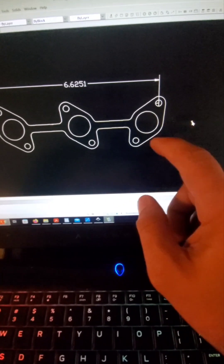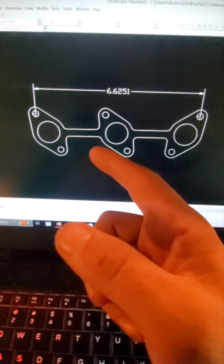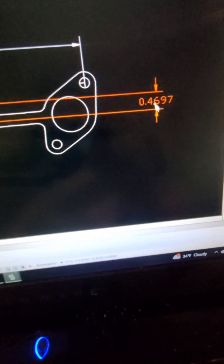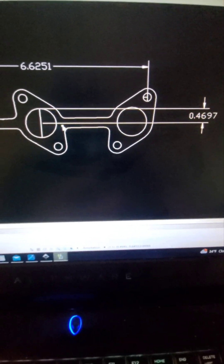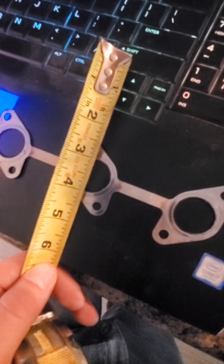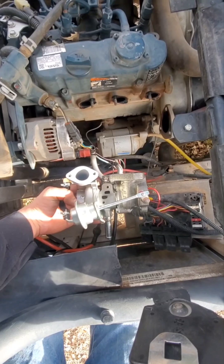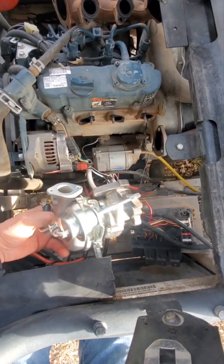I'm going to come back in here and add some mass, make this thicker across here. I'll probably cut this out of three-eighths or five-sixteenths. Dimensioning this hole, it comes out to be a 0.9-inch hole, so inch-and-a-half schedule 40 pipe fittings will not work the way I intended — I basically need to find one-inch pipe fittings. After I get a flange going, I want to mount that turbo somewhere right in there. It is kind of a lengthy turbo manifold — so there you go, part two.